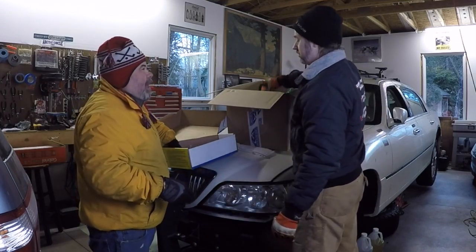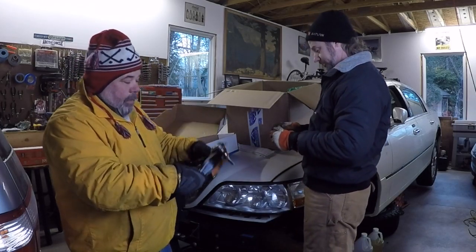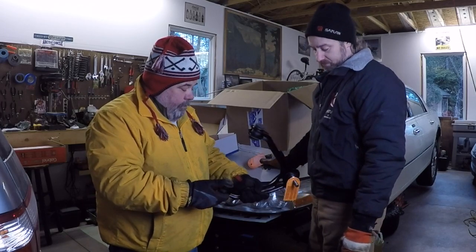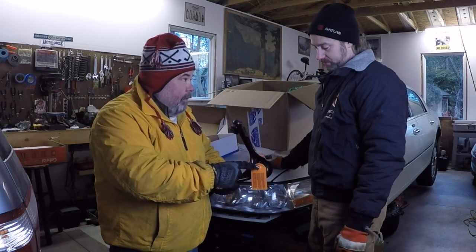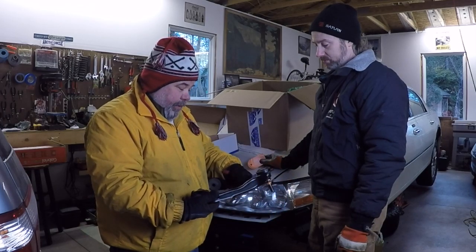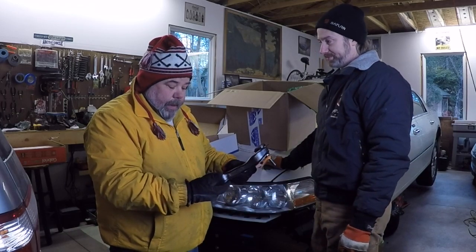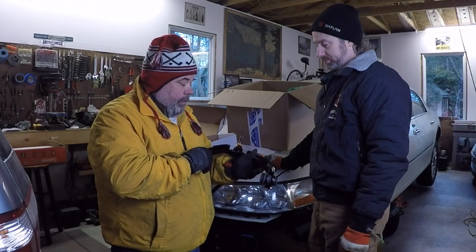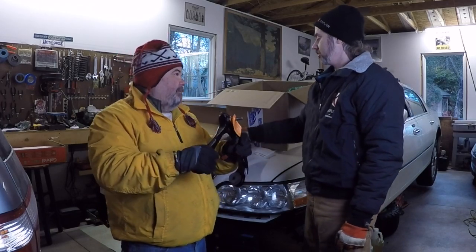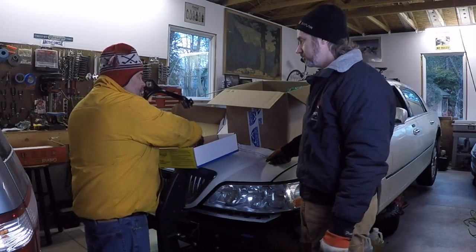This is one we cut — yeah, upper ball joint. This is the Problem Solver. It's an all-in-one upper ball joint and upper bushings, because the bushings on the ones we have are shot — the car has around 235,000 miles or so. So yeah, there's that — you got one for each side.